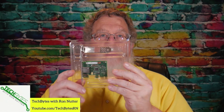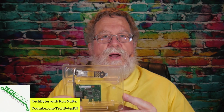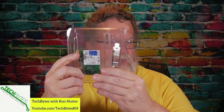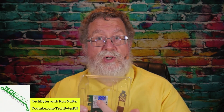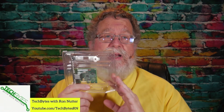Thanks to some of the folks on the FreeNAS forums, I went and got this Intel card, and it was about $40 on Amazon. Not all cards work, so I was very careful to look at the specifics of the one I was going to use. This one says it's a server adapter — don't let that bother you. This is an i210 series. If it's an authentic Intel card, it's going to have a QR code. You can take your smartphone, scan that QR code — it should take you to a website where you can punch in the letters and numbers. If it's authentic, it should come back and tell you that everything's okay.